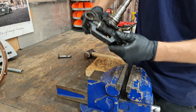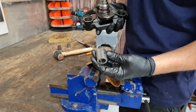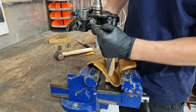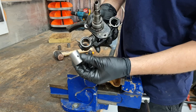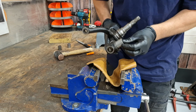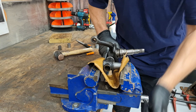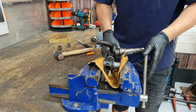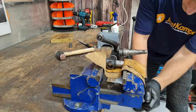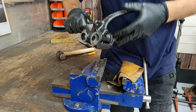That's the king pin in. Next we need to get our link pin bushes back in. Our new link pin bushes have a grease hole in the bottom, so we have to make sure that we line that up with the bottom part in line with the king pin — as the grease goes in it fills the king pin and comes into our link pin bush as well. We must make sure that's at the bottom. I'm going to push this in with the vice to get it started, a little bit of grease first. That's our new king pin in and our new link pin bushes are in.